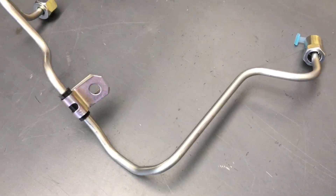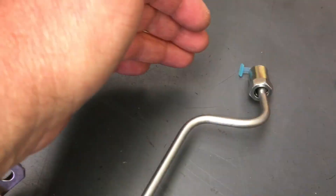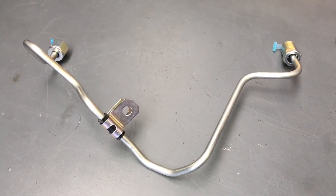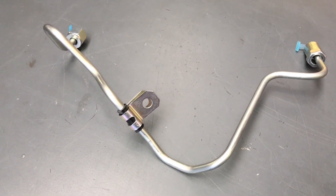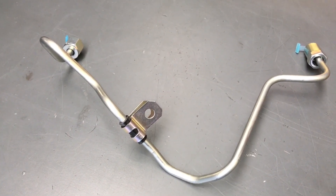The other thing you must do is use the correct torque setting — down here at the common rail and up here at the injector. New pipes: 32 Newton meters. You need a decent torque wrench. It's not just 'get a spanner and she feels about right.' Too low and it could leak, too high and it could do damage. Use a torque wrench.